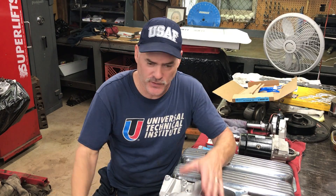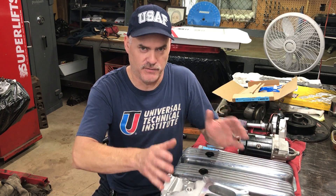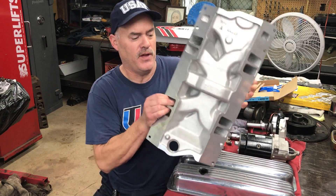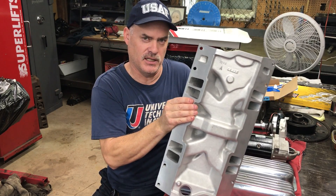Welcome back everybody. I've had a lot of questions about the Vortec heads. I don't want to get into the specifics because I have other videos that talk about that. But I had an ordeal recently with an engine that we did — it was blowing intake manifold gaskets. It was a set of Vortec heads, and if you remember, the Vortec heads only have two bolts on each end of the intake, with nothing in the middle. So this thing was blowing the intake out.